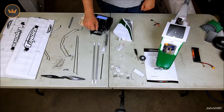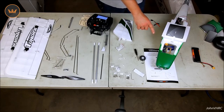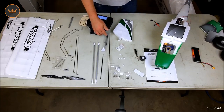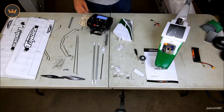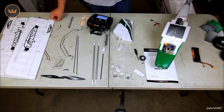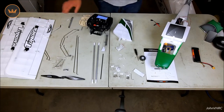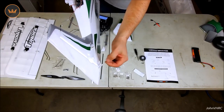There is one extra wire that comes from the ESC with two wires going to it — I hooked that to the gear switch since there's no gear, and that's going to be for reversing the ESC for going backwards. Pay attention to what way the prop spins. Now that that's done, I'll get the linkages installed — they're already pre-made, I just need to check the length. For the rudder, since it's already centered I'll screw that in till it's centered and connect it.